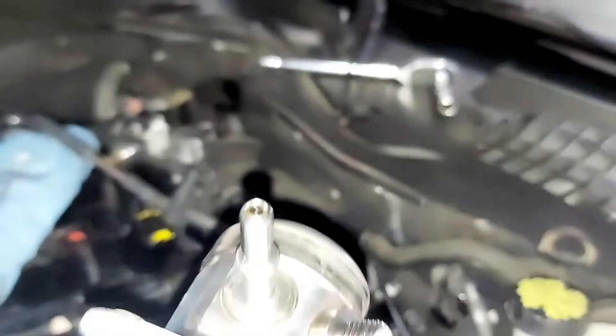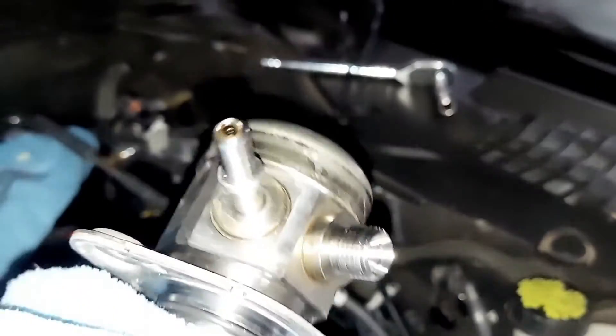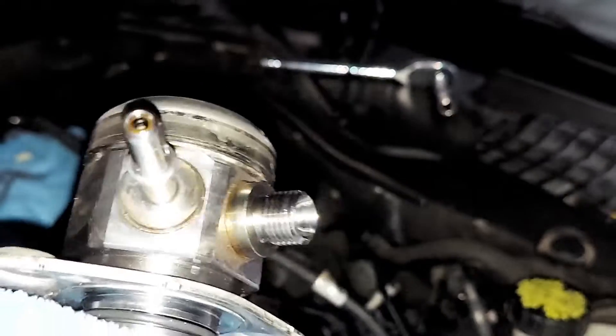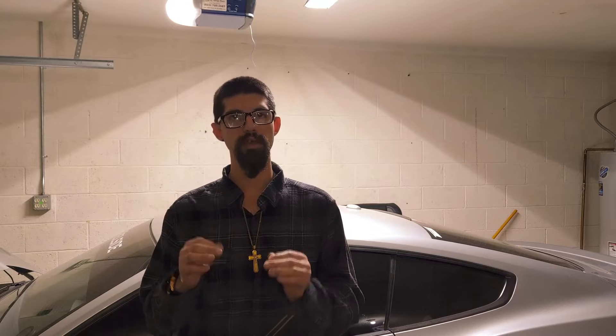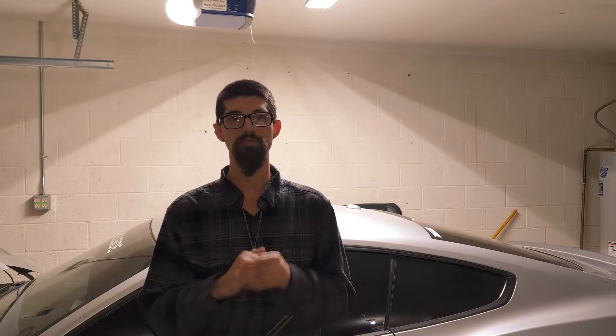When you pull these parts off, you'll be fine. This one right here — you just take off that blue tab, push on the white quick disconnect and then pop it loose. This one is a monkey wrench — you can easily take that off. You'll hear pressure release, of course. That is pretty much all for today's video. I showed you guys how to take your high-pressure fuel pump off a Mustang EcoBoost if you are having any problems with it.